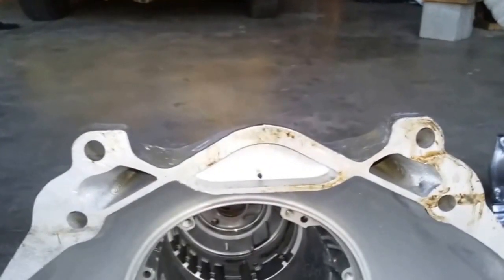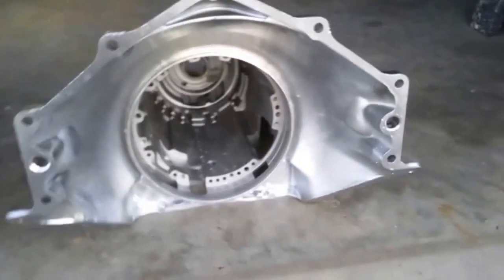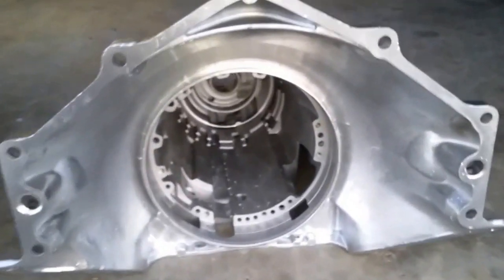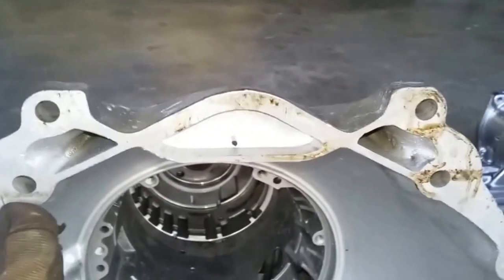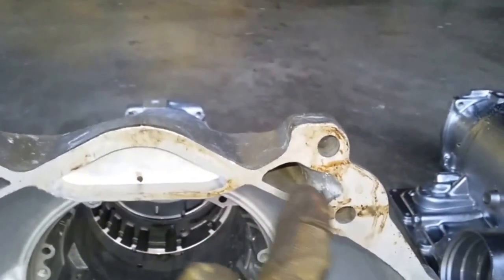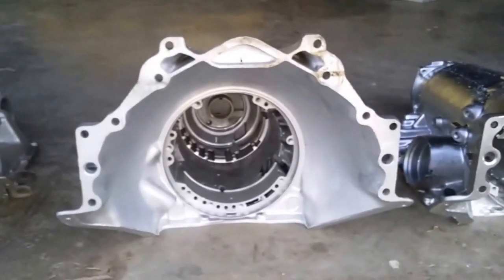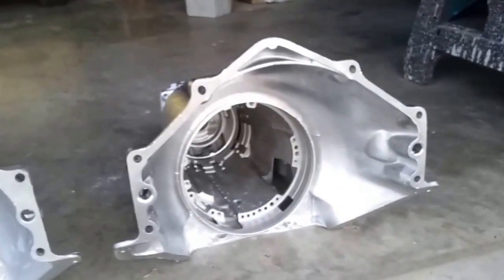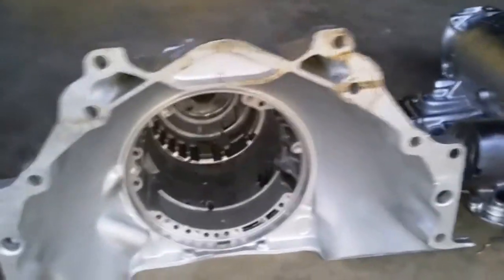See the similarity? And then — I know this is not a 350, it's a TH700 — exact same bell housing for Chevrolet. This is the Chevrolet bell housing with the high pointed peak at the top, and the multi-case has that as well. This way, the multi-case you can use either on Buick or Chevrolet. It's either one — the magic of the multi-case.